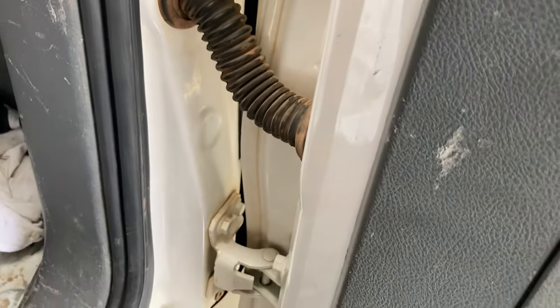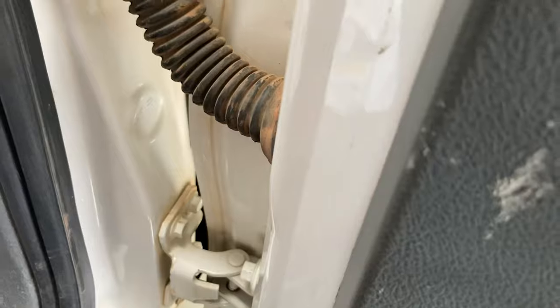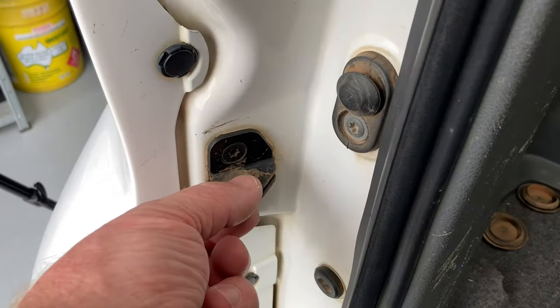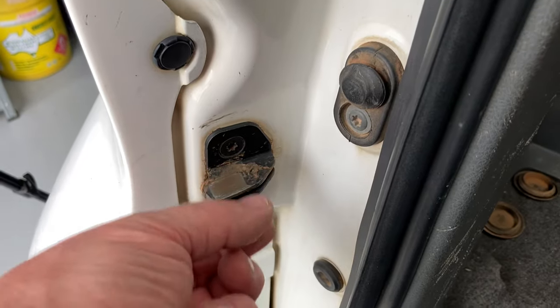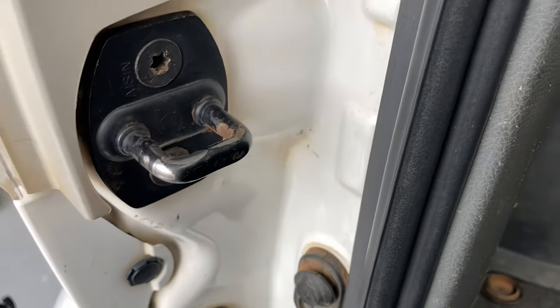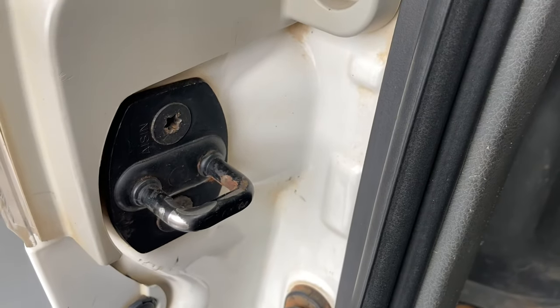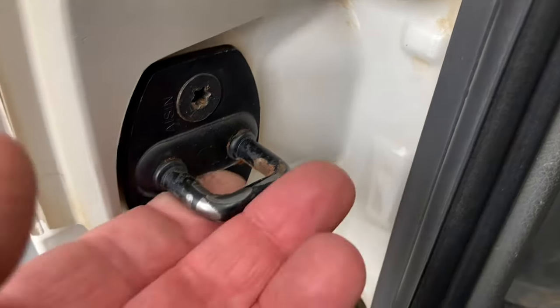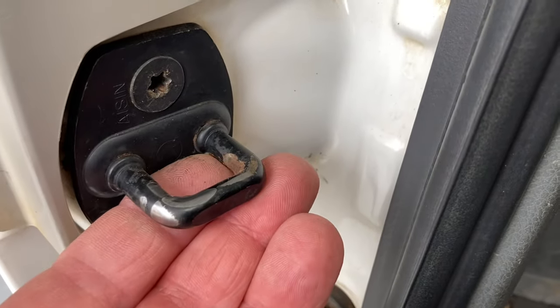On this side there's no adjustment either. There might be some wear and tear in the hinges — that's why you can get these plates from K-On that have been installed. There's either one or two in there already and that will lift the door up a little bit. If there's a little bit of wear, somebody will say you can change the bushes, but you can put those spacers in and it just lifts the door up and lines it up beautifully. The problem here isn't the door moving up or down — the problem is how far the door's held in.